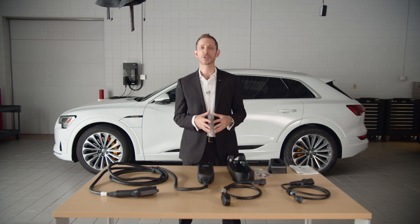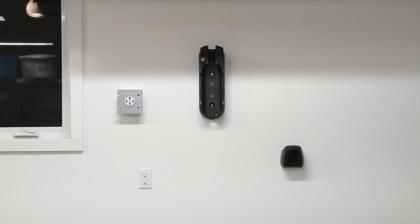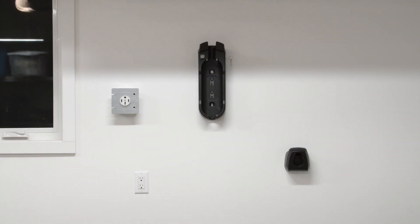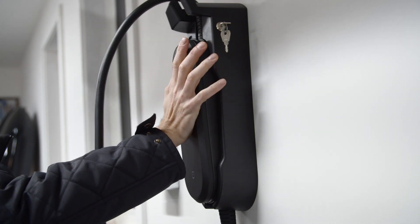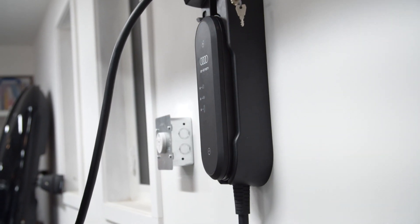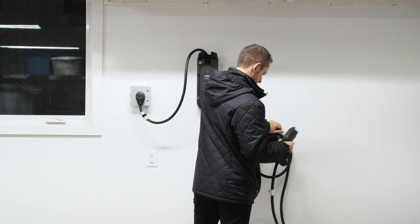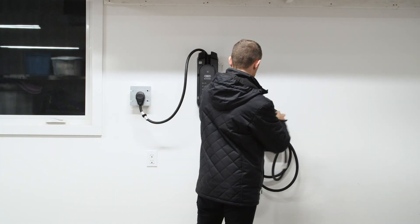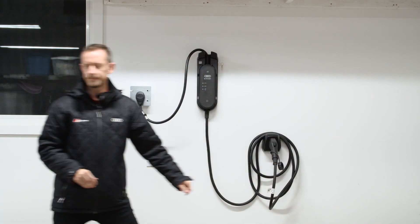The final item provided as part of the Charging System Compact is the wall clip. Consider the location of the clip relative to the wall receptacle. To place the control unit, first insert it into the bottom tabs and then into the upper tabs, then push the control unit in at the top to secure it. From here, you can wrap the excess length of cable around the charging connector mount when not charging and plug the power cable into the socket.